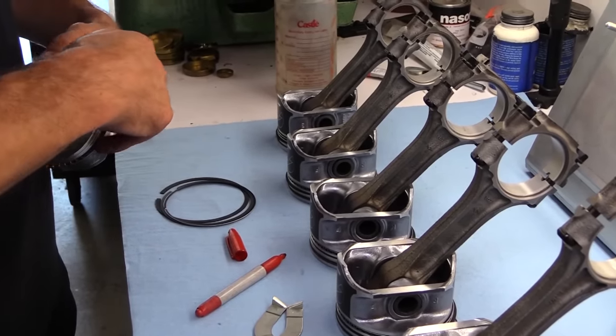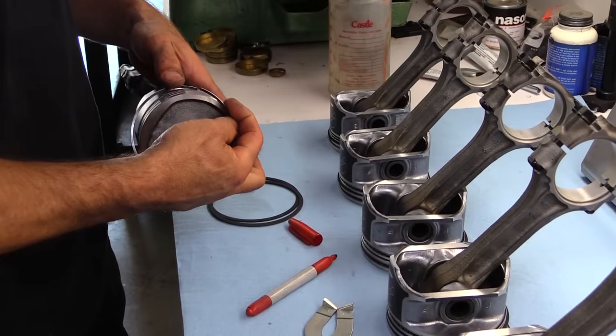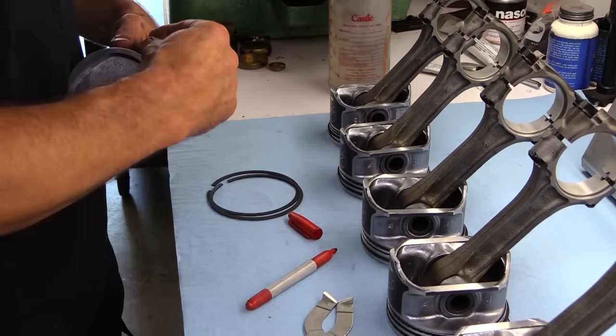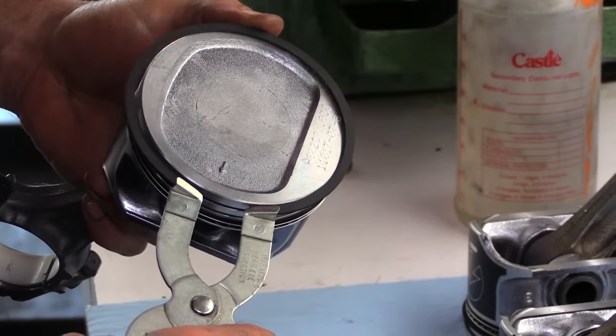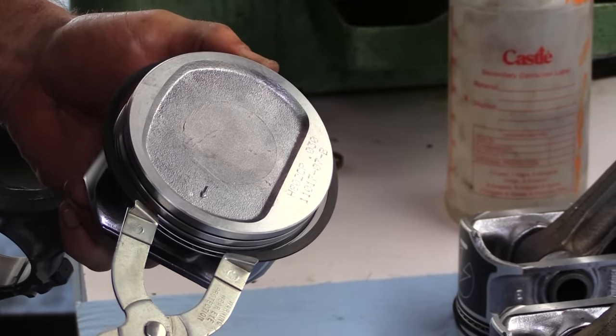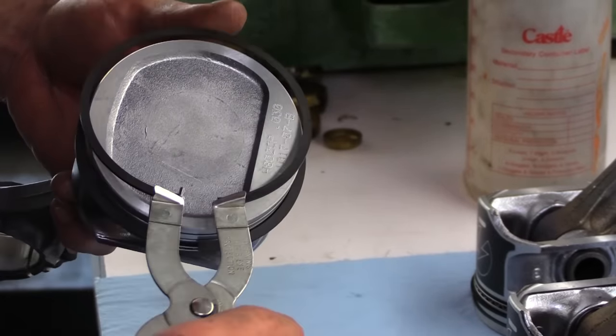The pistons, meanwhile, are all new Sealed Power hyper-eutectic castings. They are definitely better than the stock slugs, but still quite affordable. A small dish helps keep the compression ratio pump gas friendly, even with the added stroke. They're also outfitted with a 1.5, 1.5, 3mm ring package.